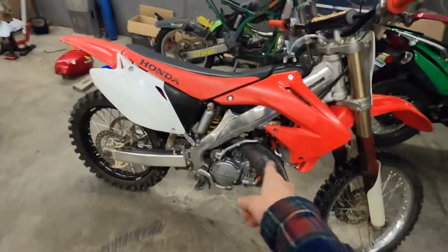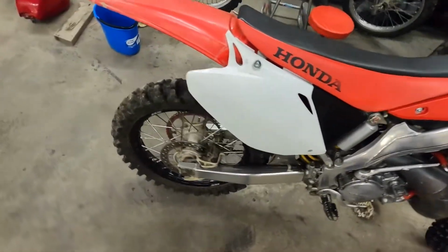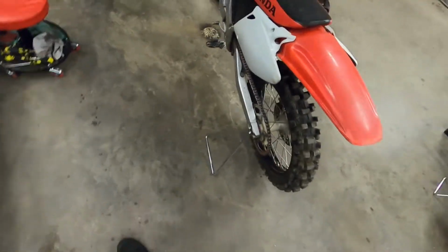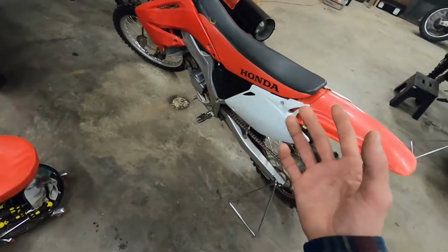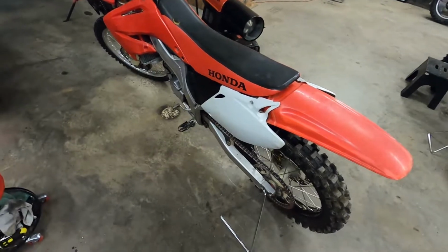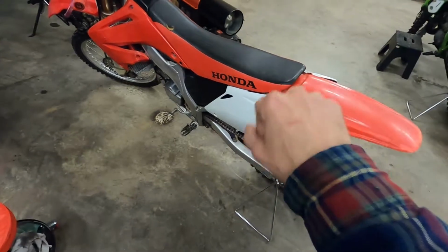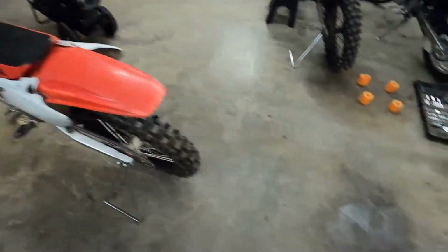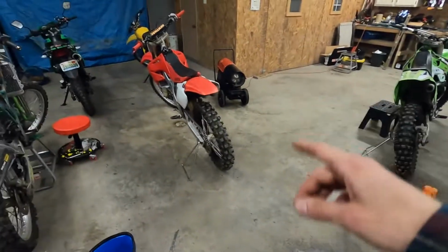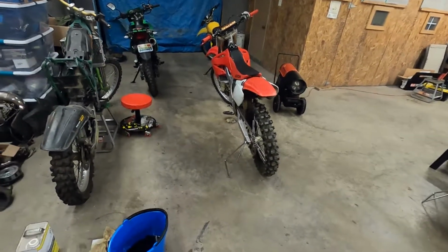So yeah, this thing does still need a little bit of fine tuning on the carb. I have not adjusted it at all since doing the rebuild, and now that it has more compression, that equates to having more air volume in the combustion chamber, so I will need to increase the fuel a little bit to even out the air fuel ratio. You may have noticed that by the little bit of sputtering that it was doing down in the lower RPMs. Hopefully the next video on that thing will be out of my buddy Cash's house, ripping up some trails and stuff like that, and get some good video for you guys.